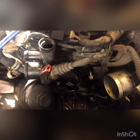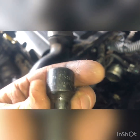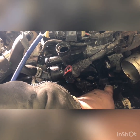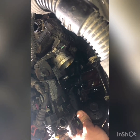You've got to have a special socket to do these. Here's your socket — it's an inverted Torx bit, E10. I've got two of them. There's a bolt here, bolt here, and one down there that's a little trickier to get to. I'm going to go ahead and take that off now, and the water outlet should come off. Before you start this job, make sure you've got your coolant bucket ready. Get that third bolt loose and it should just come right off — you're going to lose some coolant.